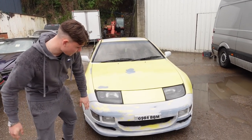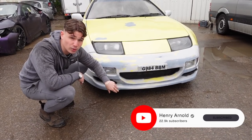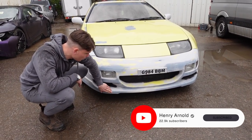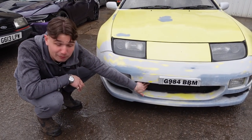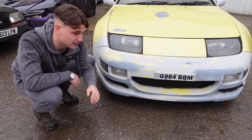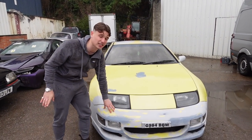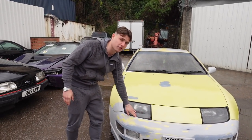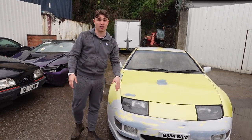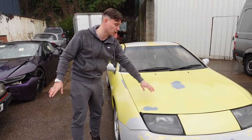If you remember in the original video, this bumper had a complete crack through the middle of it. So we've done a complete bumper repair, smoothed off all the edges and got all the grooves back in the right lines that they should be. We've blacked out the grills in here so it makes it easier for Yanni to wrap. We've also realigned the front bumper and put a new fixer in there so that it now sits in a much better position, because before it wasn't sitting very right. I've realigned all of the rubbers around the lights as well and done a full prime on the bumper and some parts on the bonnet, smoothed it over with a 2000 so that it is ready to be wrapped over.